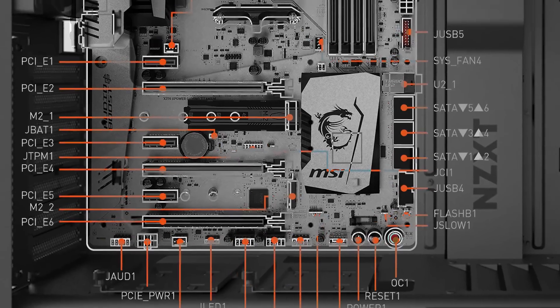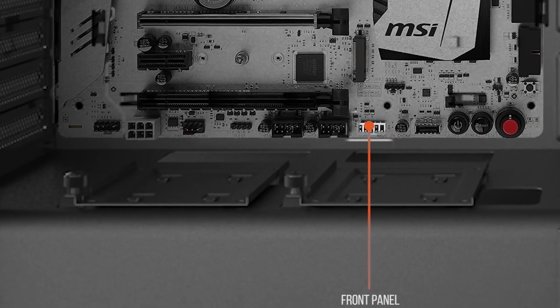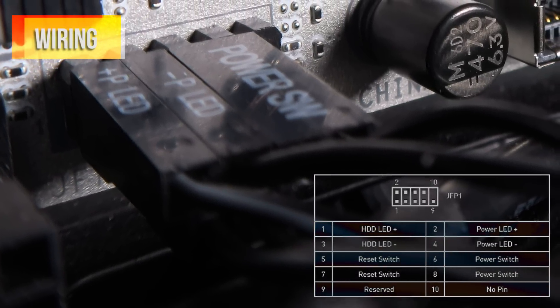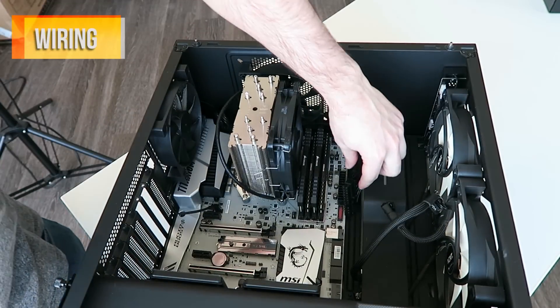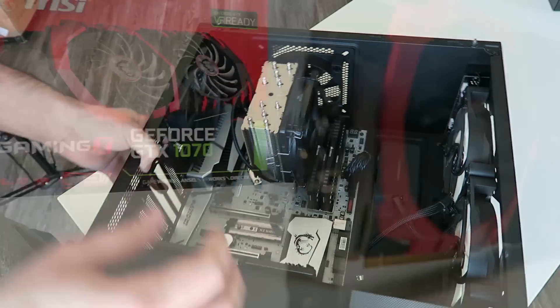Now let's get into the wiring — that's a little bit of the tedious part. Grab the front umbilical cables — that's the four tiny connections on those wires. Look for the pins right above the label JFP1. Route the four wires with the tiny connectors to connect the hard disk drive LED and power LED. Now it's also a good time to connect the large motherboard connector — the huge 24-pin connector with a clip on one side. You can't miss this one; it snaps right into place on the right middle side of the motherboard.